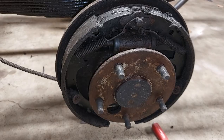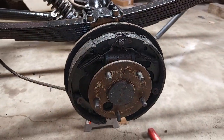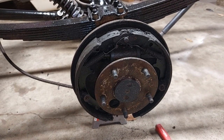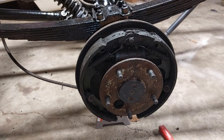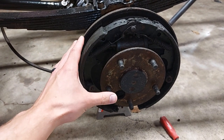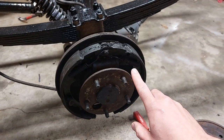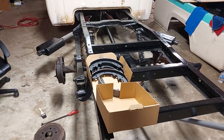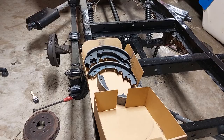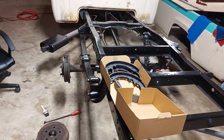Here's what we're looking at — a pretty nasty setup. Everything's completely coated in gunk. The shoe wear doesn't look that bad, but I went ahead and looked online to find some that would fit this brake drum. I'm seeing a lot listed as two inches and I need around an inch and three-quarters. Couldn't find it anywhere until I checked at the local AutoZone — I actually ended up finding them there, which was kind of surprising. When I went in they said it was like 1.8 inches, which I think is going to work.